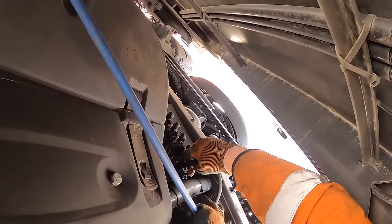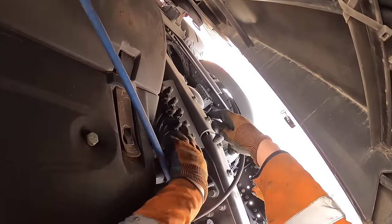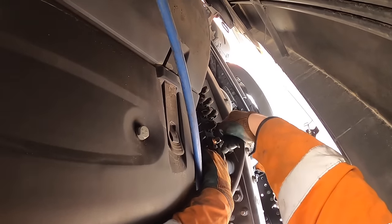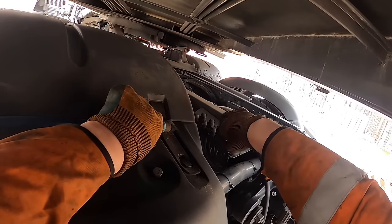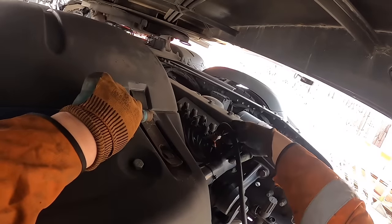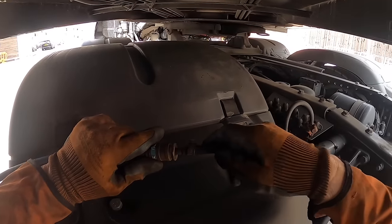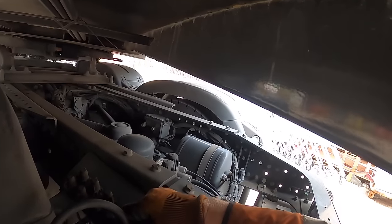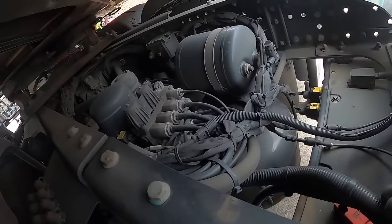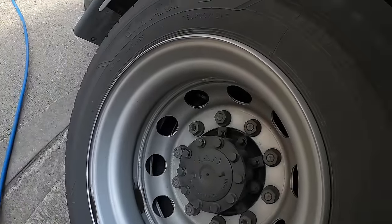I hope you can hear me over this fridge motor — it's not too noisy actually on these now. Let's try and screw that in. There we go. At the moment we've got the red Susie connected with the trailer, so by putting air into here this will also feed the trailer as well. See all these separate test points that do the airbags and whatever. And all these electric handbrakes — there's also a test point over there which will actually take the handbrake off as well. If you have problems with electrics, you can't get the handbrake off.